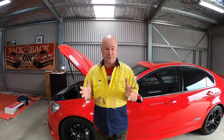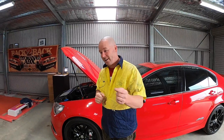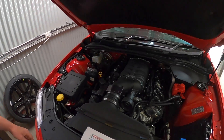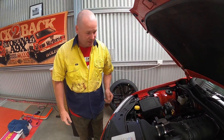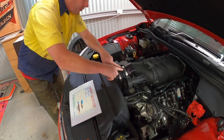The W427 was a limited-run model in the VEs, released in 2008. They needed a bank of crate motors for warranty purposes, and Gentec had one. It's a factory LS7 — 7 litre, 11 to 1 compression, beautiful heads. It's a work of art, the LS7. I was going to put the 2300 on that, but Harrop were stepping up their blowers to a 2650. We went with the 2650, much bigger headers, kept the over-the-air intake, and went up to a 102 mil Nick Williams throttle body.